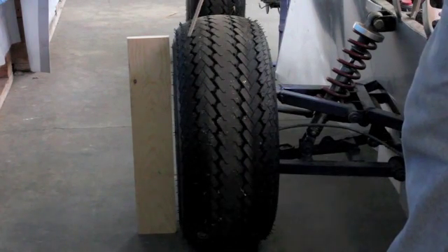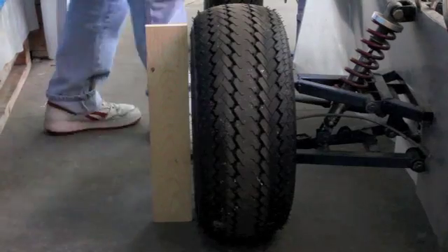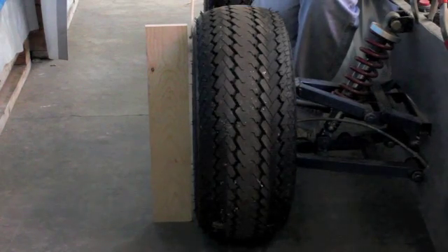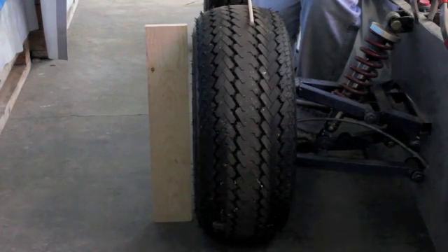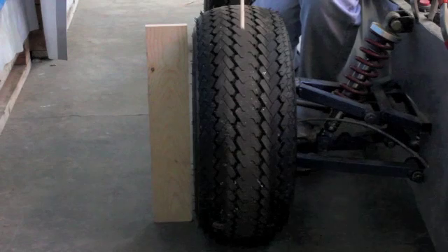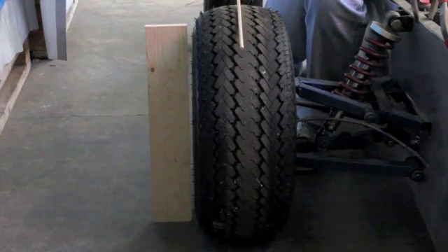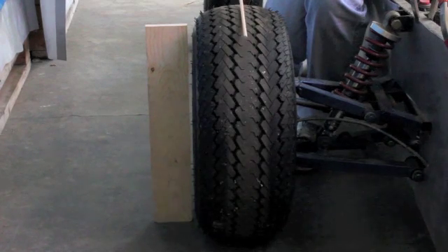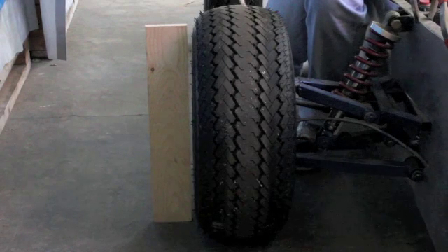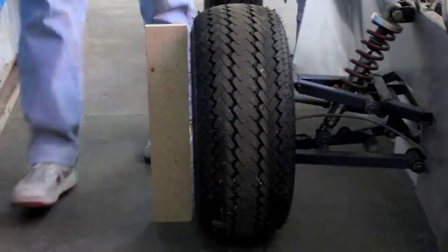The car should operate with negative camber — the top of the tire should be inward slightly. Why is it even if it's supposed to have negative camber? You've got to put weight in the car. The single heaviest component is the driver. When I put my weight over here on the cockpit, the gap changes — now it's gone into negative camber, and it's trying to ride on the inside portion of the tire. Tire manufacturers will give you a figure they like to see. For example, a tire manufacturer might say they like one and a half degrees of negative camber because they know that at normal operating tire pressure, the carcass is going to deflect one and a half degrees and tuck under, which will actually bring the contact patch vertical — bringing everything to where the contact patch is symmetrical and the wheel loading is vertical.